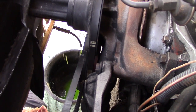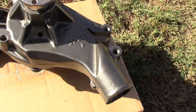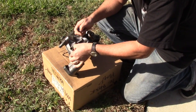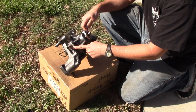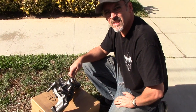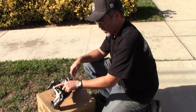Thank you. Here's the new pump, all ready to go, courtesy of Davis. And always throw paint on it before you install it. That way things stay nice and clean. Replace the steel or cast water outlets with brass fittings, get them at your local hardware store. MPT threads, it's brass, won't corrode, won't rust. That corrosion won't get inside your pump, won't get inside your cooling system. So always a good tip, go with brass fittings.